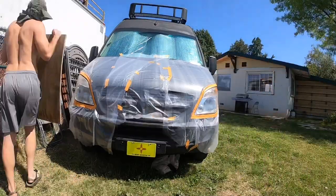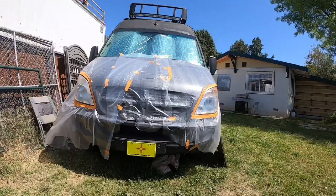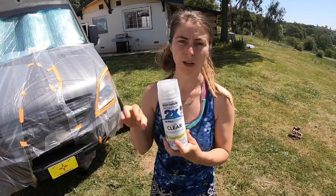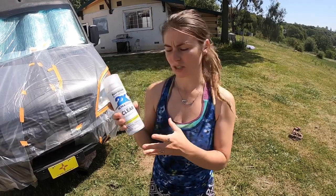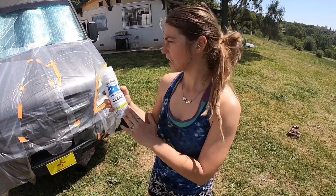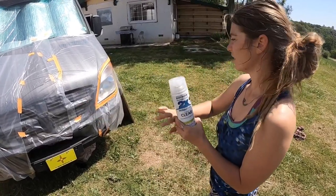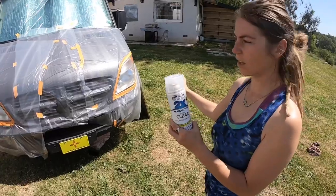We did three coats, waiting five minutes in between each coat. What this is going to do is resist all those UV rays that oxidize and turn the lights yellow, so you're really protecting your lights for a long time. Hopefully that'll stop your problems from getting yellow again.